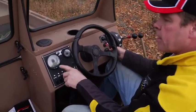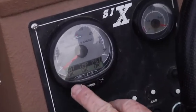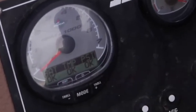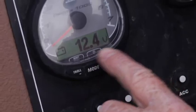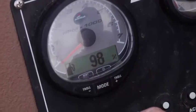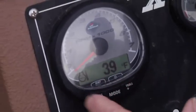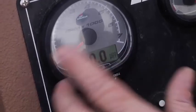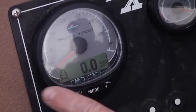I'm going to turn the key on so you can see the gauge and some of the features of the Mercury SmartCraft gauge. You have indicators showing your battery is okay, your temperature is okay, and your water pressure PSI is okay. The bottom of the gauge is a mode switch — clicking through shows 12.4 volts on the battery, 90% fuel remaining, a temperature reading, and water pressure. When running on step that would be in the six to eight PSI range, lower at idle.